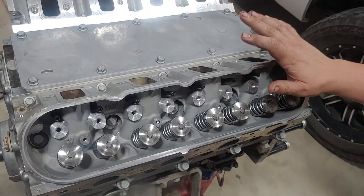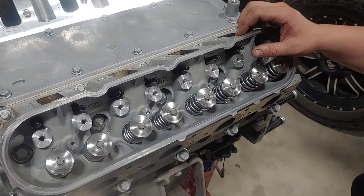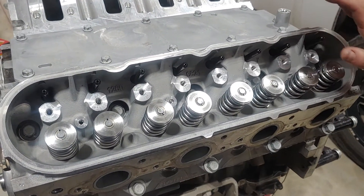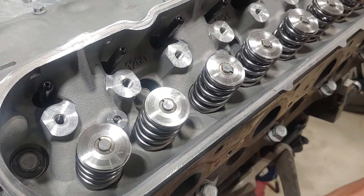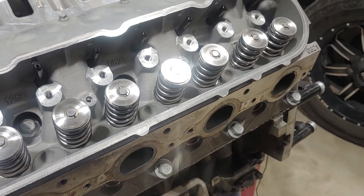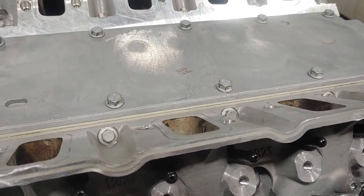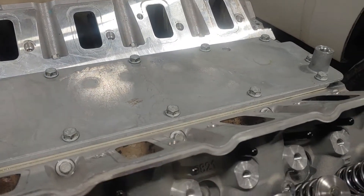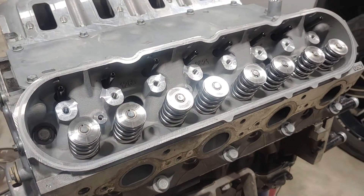Once you're done, that's all you got to do. Then you can put your pushrods in and do your rocker arms and you'll be set. We've already torqued both of them. Put the oil pump on, put the timing cover on, the oil pan. Clean the oil pan real good, new filter, gaskets. Next video, we'll be showing you all how to do a couple more things. But that's it for this video.